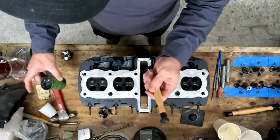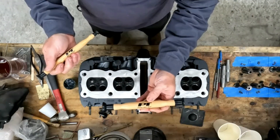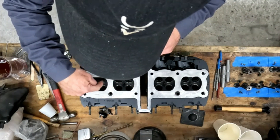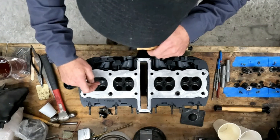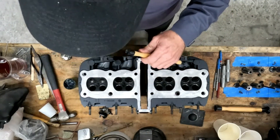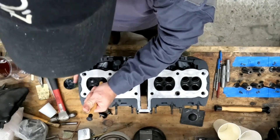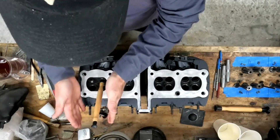These kind of tools are available at your local auto parts store. They usually come in a set - they'll have a really big one and a smaller one, so they're for various different valve sizes. These valves are sometimes a pain because they've got those big stamps in there and they're concaved out on the valve, so it makes it sometimes a booger to actually get suction on there. You just need to wet the interior surface and smoosh it on there like a suction cup.